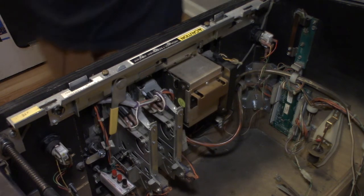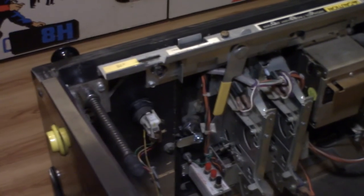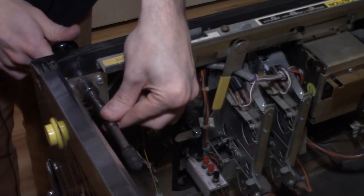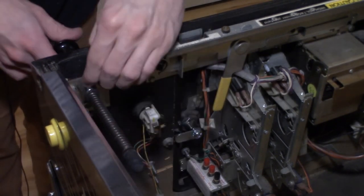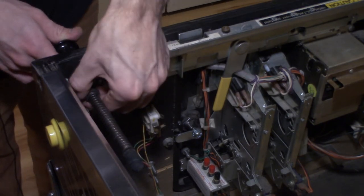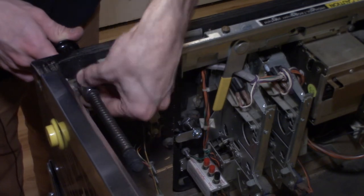And now we will rebuild the shooter rod. All right, so I have brand new shooter rod parts. I got a new shooter rod. My brown spring from Marco's just came. I got a new E-clip, new washer, new shooter sleeve. This thing really needs to get cleaned up, but I'll do that after I swap it out. I'll just grab some simple green and wipe this down.